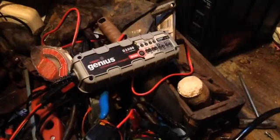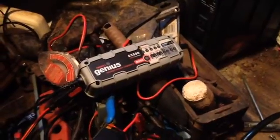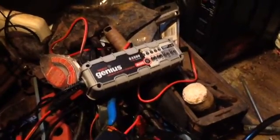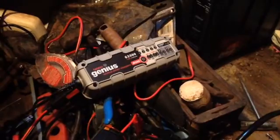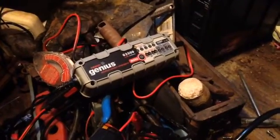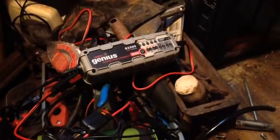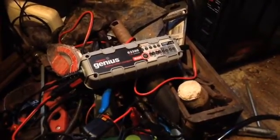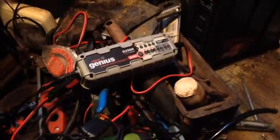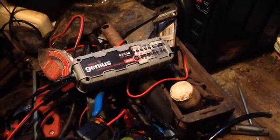It may sense whether a battery is fully topped off at 14.7 volts or something, whereas my certified charger maybe only goes to 13 or 14 volts. But in the end, a charged battery is a charged battery and I don't know if it extends battery life at all. That's my review — I wouldn't suggest this unless you have money to burn. I could not find any good reviews, so I had to buy one and find out for myself. No, it doesn't really help with heavily sulfated batteries, and the website certainly doesn't go to any length to stress that. Obviously they want to sell that as a feature.